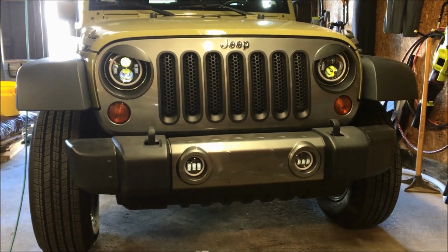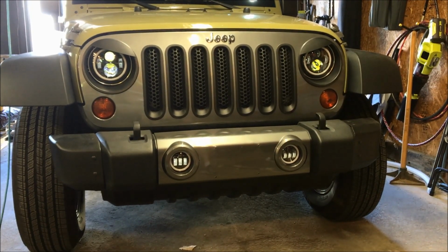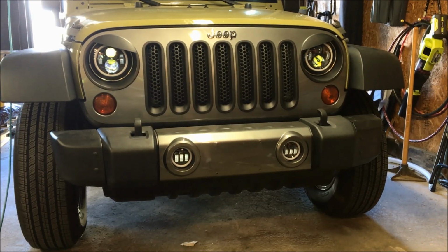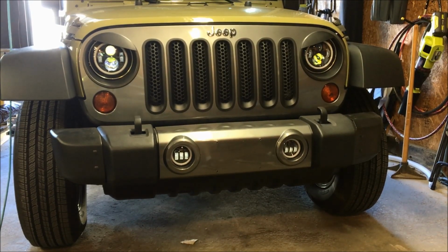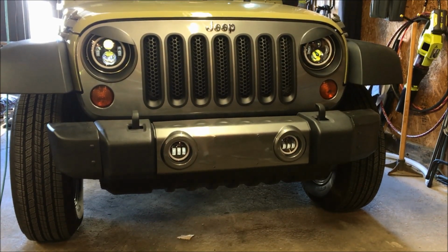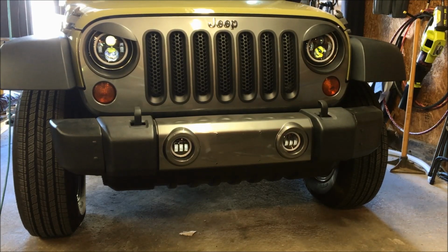Right, so at this point we're all set. The job is done. And you know what, whenever you do electrical, you really need to take your time and do it right, because electrical is one of those things, if you do a shoddy job, it's going to come back to you pretty quickly, and you're going to start chasing issues and everything else. A lot of this stuff can be eliminated when you're doing the install. Take your time, get the right materials, know what you need to do, and just make sure you're doing the right thing. Have everything in wire loom, make sure everything is crimped correctly, test all your connections, and make sure everything is watertight as far as your connectors.